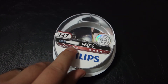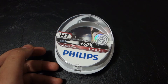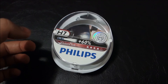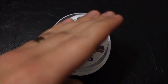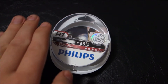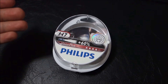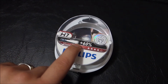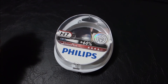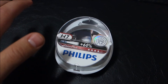I don't really like what they show you on the packaging — that you get a bigger distance with these bulbs. Because with H7, from what I know, all of these headlights have glass, so the light is concentrated and has a very specific shape on the road. For the lights to have a longer travel distance it means you actually have to raise your beam, but raising your beam you start bothering other people in traffic. I don't want a longer distance — in the short distance where I've set my headlights I just want more powerful light in the same area.